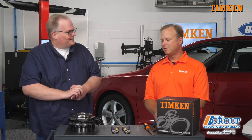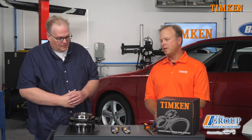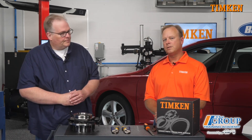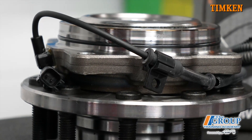So what can't the technician see? One of the things that contributes to the performance and durability of the bearing is the quality of the steel. The cleanliness of the steel leads to the long-lasting fatigue life. In fact, oftentimes when you look at a value line bearing, the quality of the steel is such that you're not going to get the fatigue life and the bearings will spall.